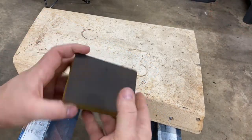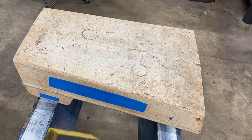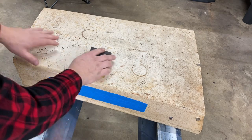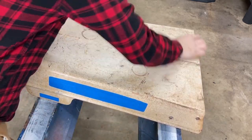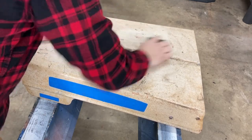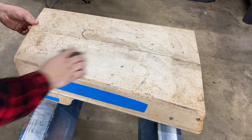My new microphones have failed me, so we're just going to do a voiceover on this. What I'm doing here is showing you that I've got a 180 grit block, and we're going to go ahead and use it to sand down this hood. As I'm going along here, you can see that there is quite a bit of surface rust and dust that comes off of there. Once I'm done with this, we'll go ahead and wipe it down with some alcohol, let it dry, and then we'll coat it with some white paint.